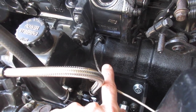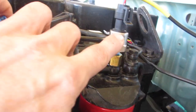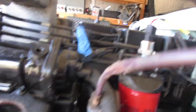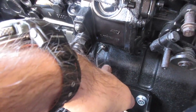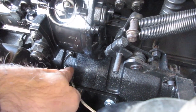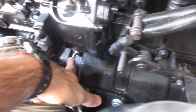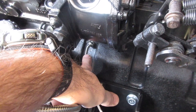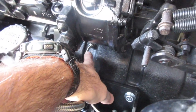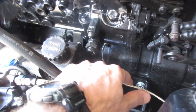This location, usually on an OEM Dodge application, is the oil pressure sensor. That sensor is plastic with a little pigtail and is prone to crack. I had one crack on the 80 even though it was unused — it was just there to block off the port — and it started leaking on me. So I just used a regular 1/8 NPT plug. On this one, this is a solid sensor, so hopefully that doesn't leak. It's just oil temp, which most vehicles don't have, but I would like to monitor that.